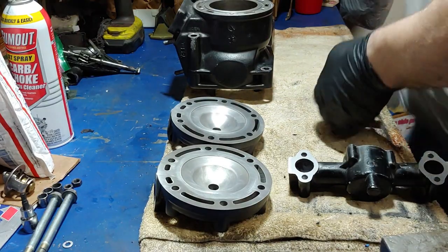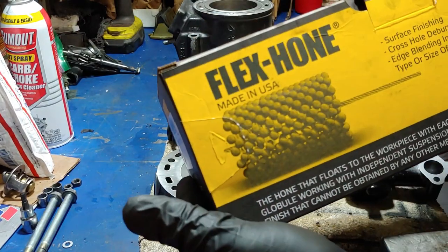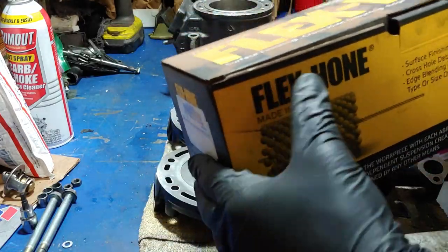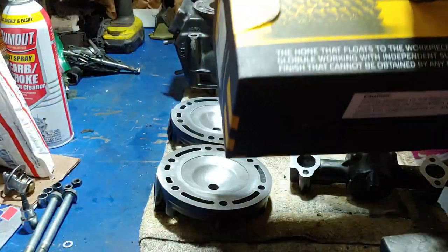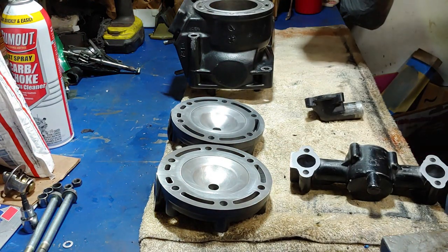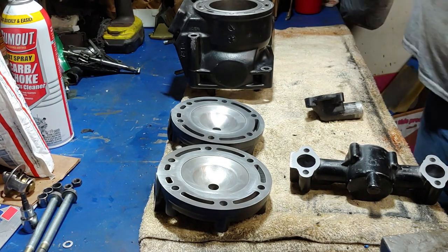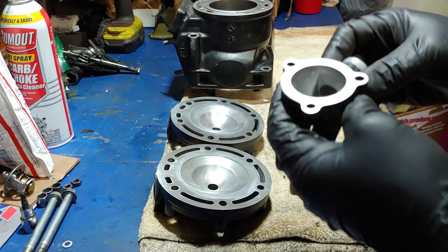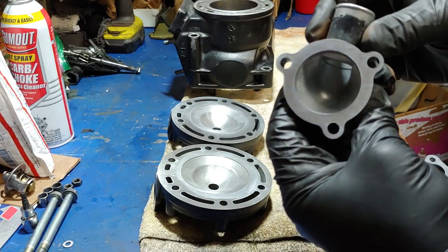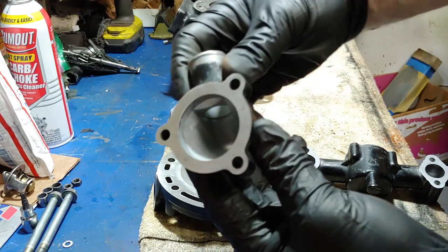You'll hold oil but you won't get as good a seal and probably not as good compression. So you're better off just running a few passes with the aluminum oxide ball hone. I use the Flex-Hone and it's done me right. I use standard automatic transmission fluid as a cleaning agent as well. Then I also did some lapping on the coolant ports.